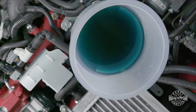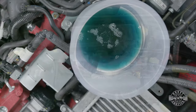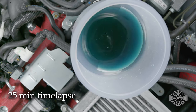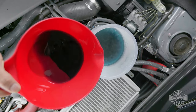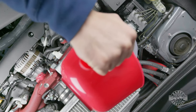I'm going to go ahead and start the car so we can start purging the cooling system of air. It took me close to half an hour to do this completely, so make sure you have the time. Every time an air bubble escapes, it gets replaced by coolant from the container. If it gets low, add more coolant and keep it to about a third throughout so you don't suck air back in.